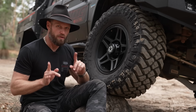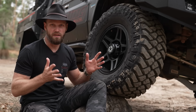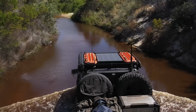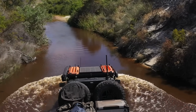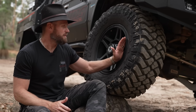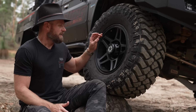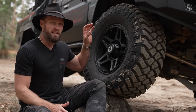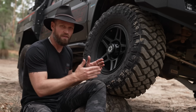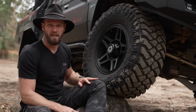People are gonna say I'm pro steel, and I am pro steel. If you only have one spare, definitely gotta have steel wheels. I have aluminium now. So as you'll note in the back, I'll have two spares now. And I'm always gonna carry two spares so long as I have alloy wheels or aluminium wheels. These are P-Core wheels, negative 25 offset. They are 17 inch, which means that I now have a little bit less sidewall, but having almost 35 inch in size, there's heaps of sidewall as there is.